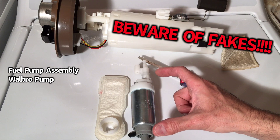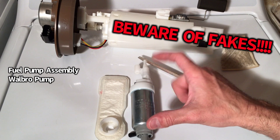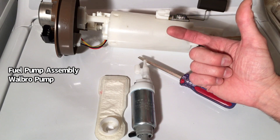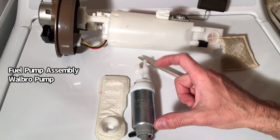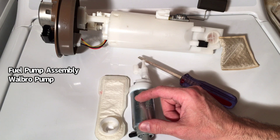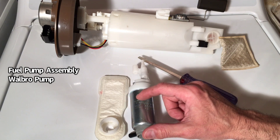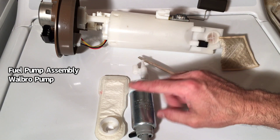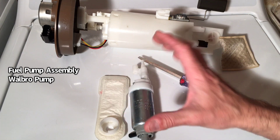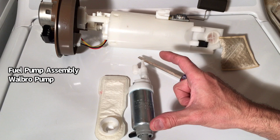You want to be careful with online purchases such as eBay or Amazon — there are a lot of imitation knockoffs out there. There are some easy ways to pinpoint if it is a fake, as far as the logo, the 'W' with the Walbro, the way the font is laid out, and the way the logo is stamped on there. There are also ways to tell by how the housing has been put on. Do your research and make sure you're definitely getting what you're paying for.